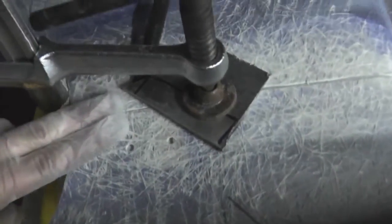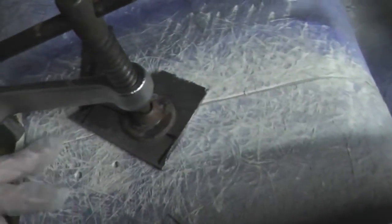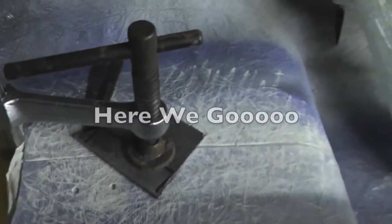I'm now ready to put on one layer of glass fibre, a little bit of resin and another layer. I'll put about two layers, but they're really thin layers, just to strengthen the back bit there and the back bit there, because it'll stretch a lot there, but it'll move most there. So we're going to go ahead and do that. So here we go.